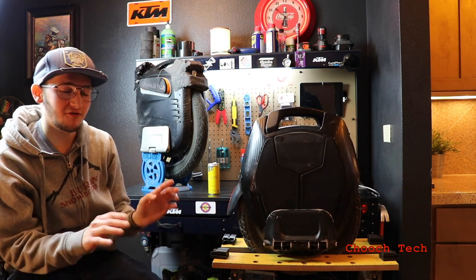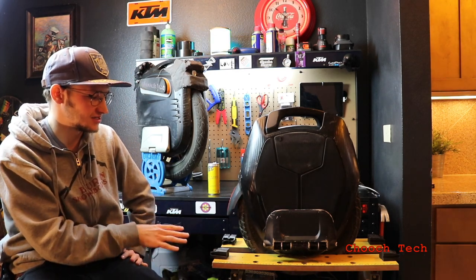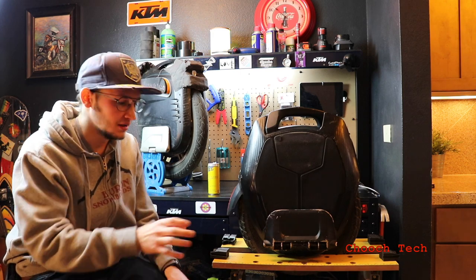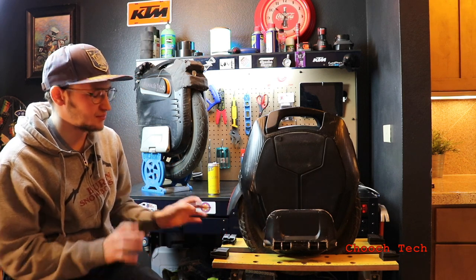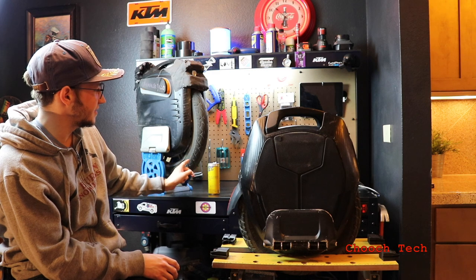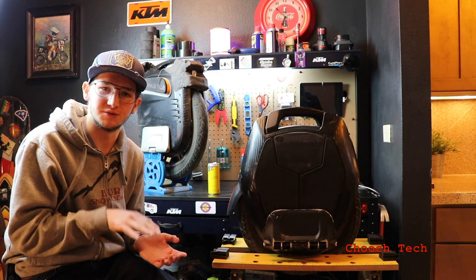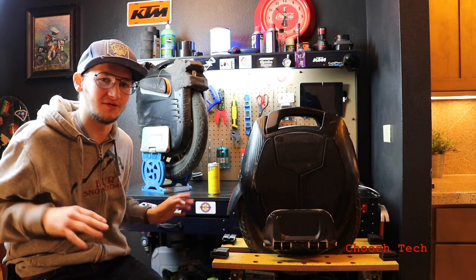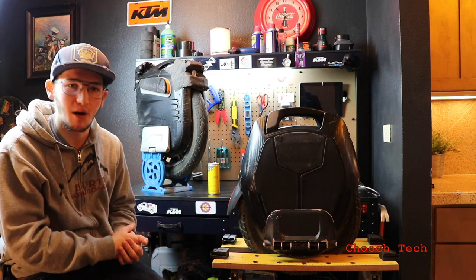The new tire they're shipping with — my absolute favorite thing about the Kingsong 16X itself is the tire on this thing. It's the perfect tire right between — it's what the Z10 tried to be. This tire still has a tube in it; the Z10 was tubeless. It's not quite as thin as the MSX tire and not quite as thick as the Z10 tire. You can really bounce curbs, bounce over rocks, and take incredible terrain on this thing without ever worrying about denting your rim. Running a hefty air pressure, you can just tank potholes and bumps.